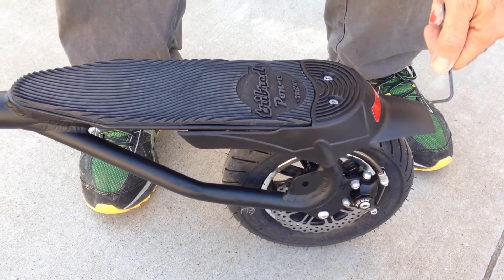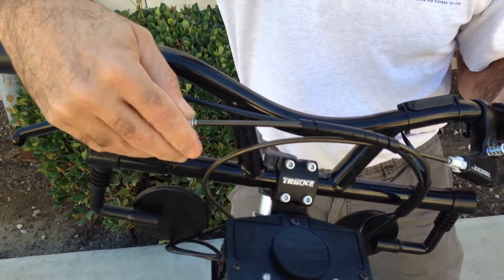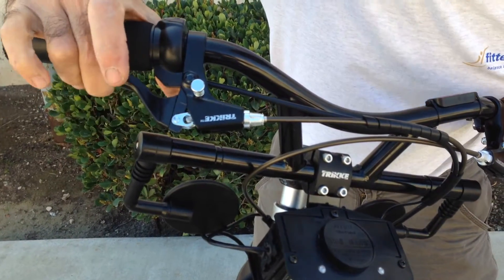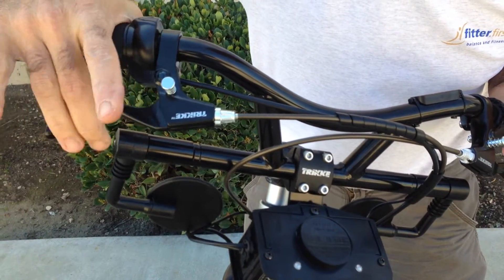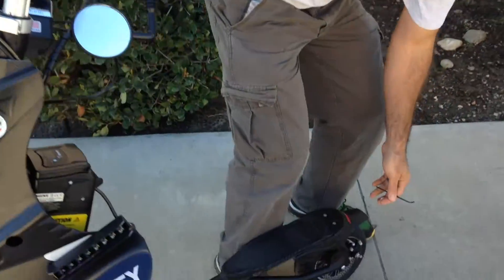I will show how to adjust the brake. We don't want to adjust here on this adjuster. I want this adjuster all the way retracted and tight. You can see here that the brake is really almost touching the grip, and there's no parking brake basically. So we'll stretch the cable, adjusting here at the caliper.